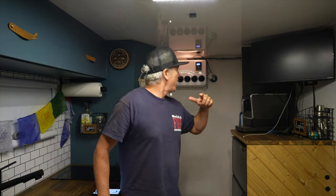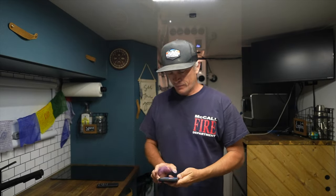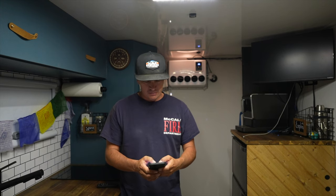I'm going to make a note of our power used so far — we've used 12 amps out of our battery on the 24-volt system, which would be 24 amps on a 12-volt system. I'm going to let this sit for an hour and see how many amps go through over the next hour now that it's reached its set temperature. The numbers are in — pretty impressive. It's been an hour and we have used 14 amps from our 24-volt battery bank, giving us about 350 watts of power used in an hour.